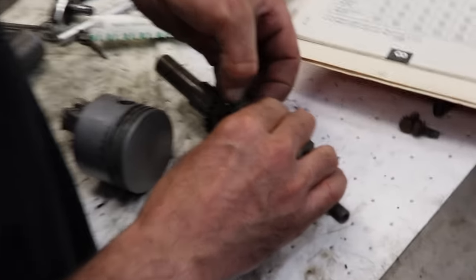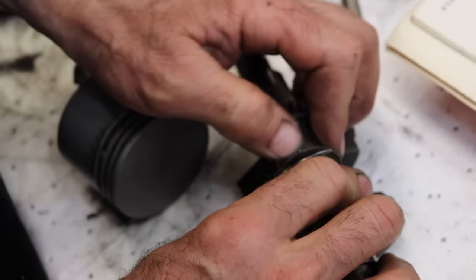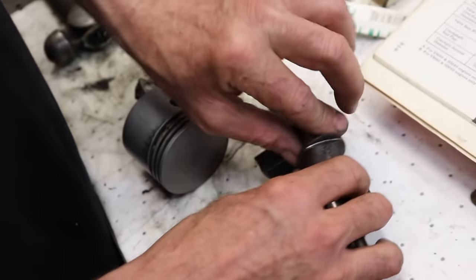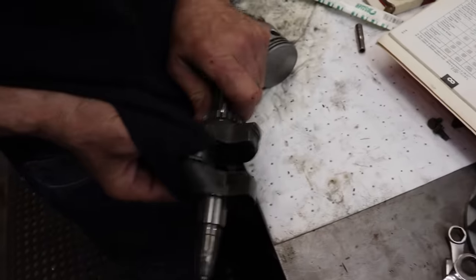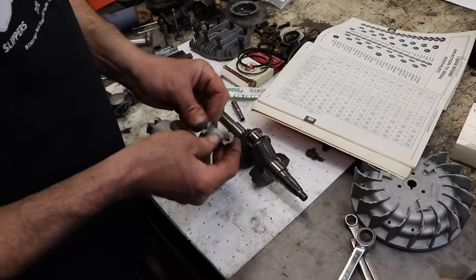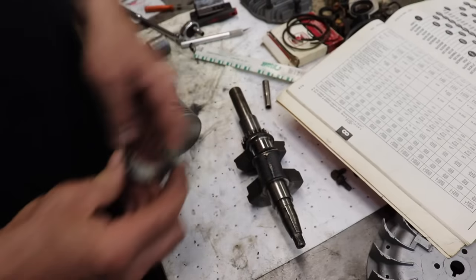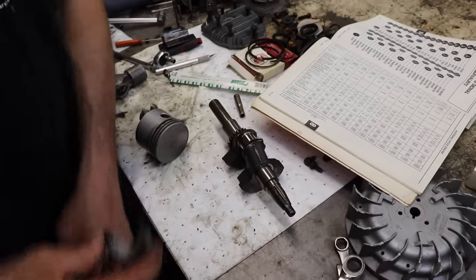So now you got to get that off of there. You don't want to leave that on there. You don't have to use the crocus cloth. It'll come right off. Use my shirt. Then clean it off the cap. It's going to be a little bit in the cap. You could clean the cap too if there's some on there, if it transferred. Usually stays on the journal.